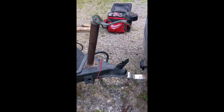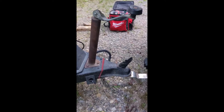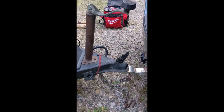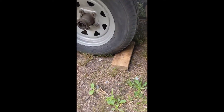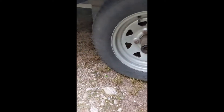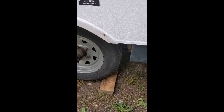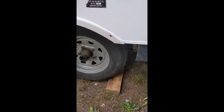Now you want to get the camper off the hitch. We're going to use this jack here to push the camper up and drive the car out. Before we prop the camper up with the tongue jack, we're going to put some blocks in — in front or behind depending on the ground. This ground is sloping down, so I'm going to put some blocks behind the wheels to stop it rolling away when I push it up.